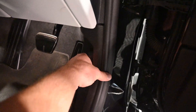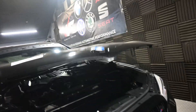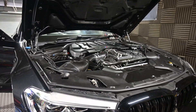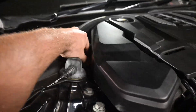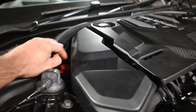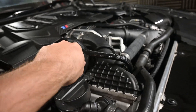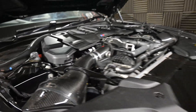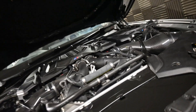When it comes to a battery stabiliser, just reach down here and give that a double pull, then come around to the front of the car and look up the bonnet. Here is your live point, and before your earth you can either go on one of these points or jump up onto this tab here — that's going to give you good battery support so while you're flashing you don't run out of battery.